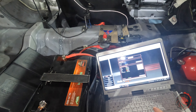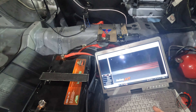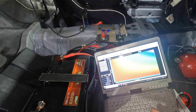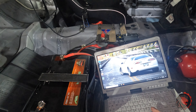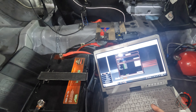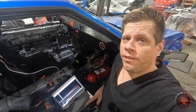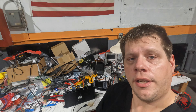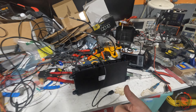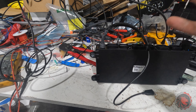Encouraging. Send what I have to the ECU. Synced. Is it really, though? Yeah. Restart. Open. As you can see, we can talk to the ECU again. That was a very annoying fix, but it can be done if you know a little about soldering and have the right tools. We have pretty much the same repair that Holley will do if your ECU is fixable and you send it to them — put a dongle on it, epoxy the pins, good to go. But if your pins are broken off at the epoxy, too bad — use CAN bus.